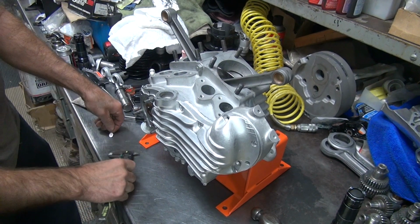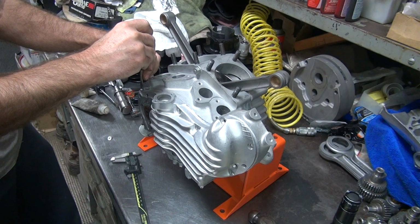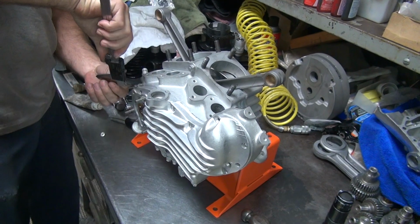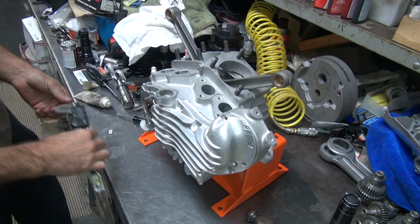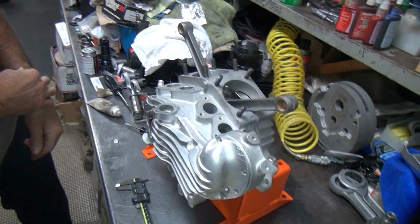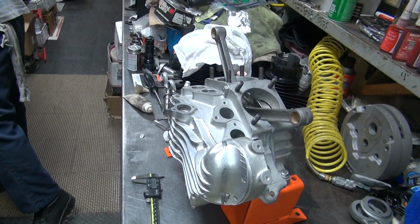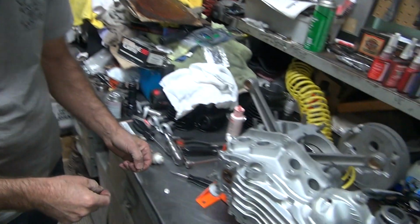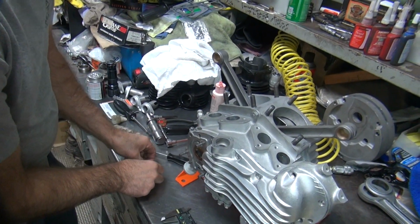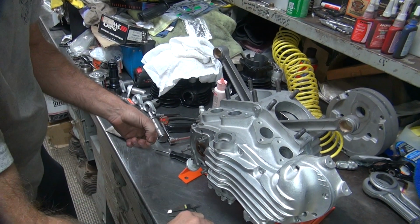77. Okay, if we go down a half, a quarter, 3/4 of a turn, 80 thou. So this is set up for a little bit under 3/4 of a turn down. Now over here I found a washer. Do we know where it came from? Perhaps that's it. I think it's one that he needs to be using.